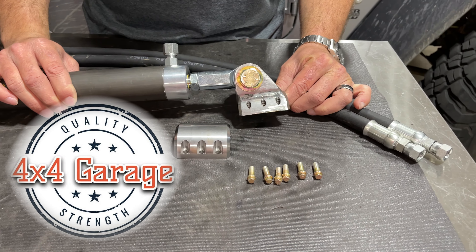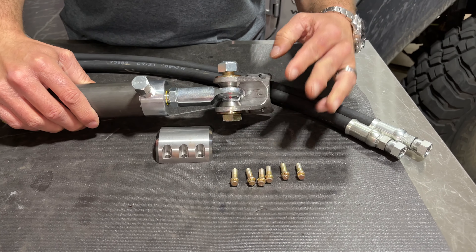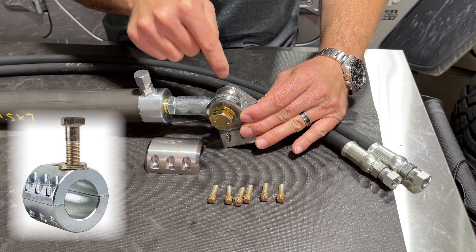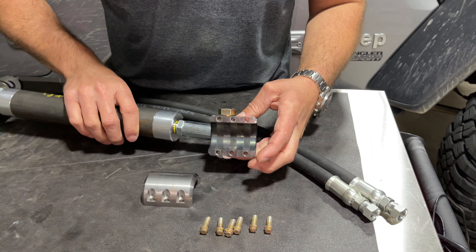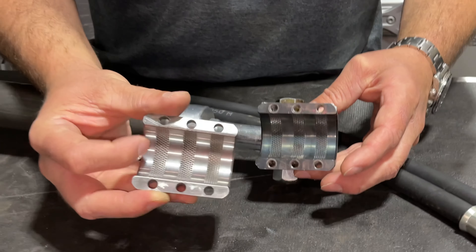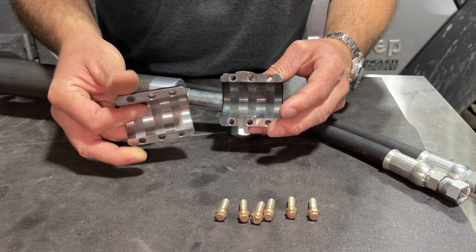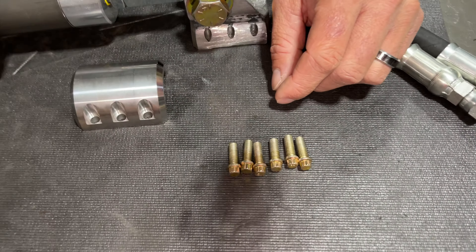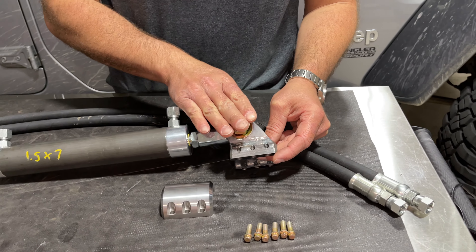One of the products I really wanted to show you is this new tie rod clamp from The 4x4 Garage, made by a guy named Chris right out of the Pacific Northwest. He actually fabricates these out of his shop. It's a double shear mount, so you've got the added strength you need with your hydraulic ram - if you do just a single bolt style, those can come loose and you can lose them on the trail. He also does something pretty unique: these are knurled so it clamps down real tight on your tie rod and won't pull, slide, or move on you. He uses 12-point military grade bolts, which are a lot stronger than the allen style that traditionally come with these.